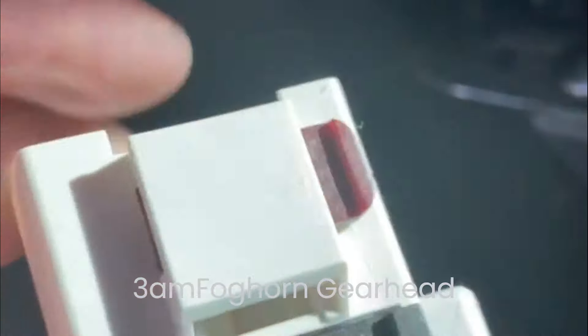Here's what the brake switch looks like, and here's the new one I got for my 2006 Dodge Durango. One thing I wanted to point out is there's a red tab that locks it in place once it's plugged in. It's located right up there near the brake pedal — there's the electrical connection. I'm going to plug this back in and then you'll see me put it in.